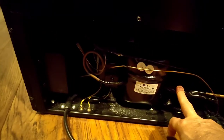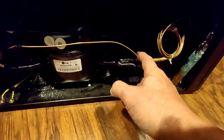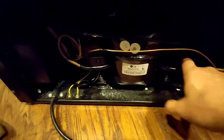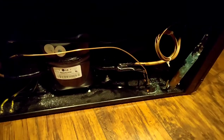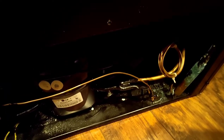This compressor has two low pressure inputs and two high pressure outputs. We're going to put this Supco bullet piercing valve here because it's the longest straight piece of copper — the other one curls straight up. We'll hook the gauges to this to find out how much pressure it has, or if it's a vacuum. If it's a vacuum, we obviously have a leak.